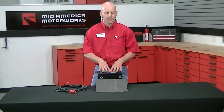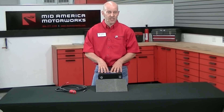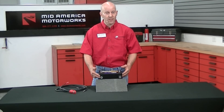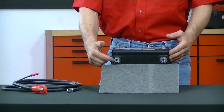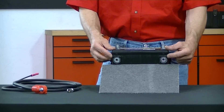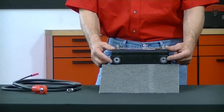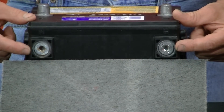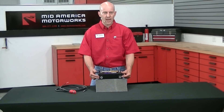When we're talking about battery maintenance, we're talking about accurate tests and also inspecting your battery terminals correctly to make sure that there's not a problem with any type of oxidation. In this particular case, we have a side terminal here and you notice the terminal on the left is actually oxidized. You can see the oxidation in this location right here, whereas the negative battery terminal side is actually nice and clean exactly the way it should be. This level of oxidation can sometimes create problems with battery tests, so it's always key to accurately look at the battery terminals prior to battery testing.